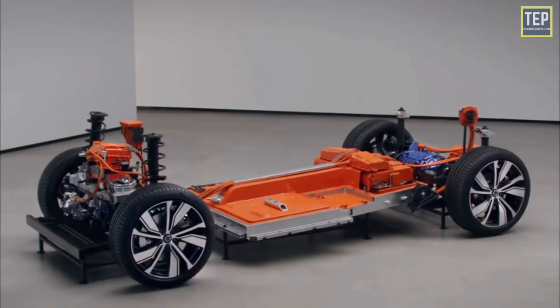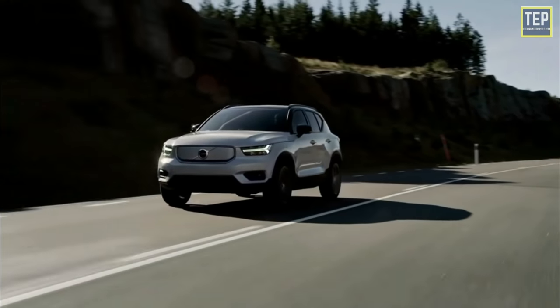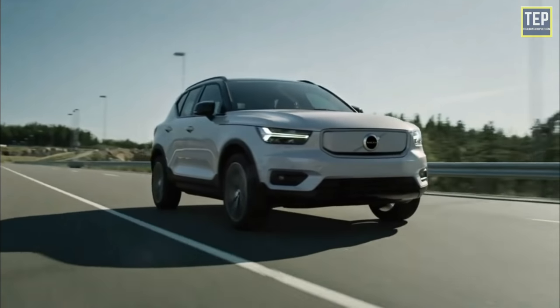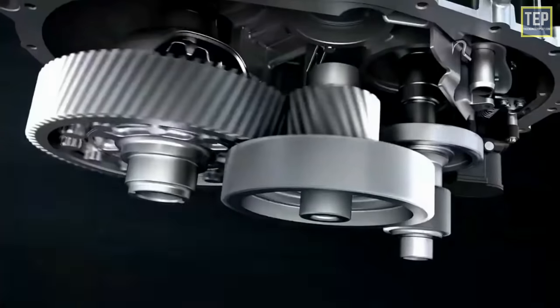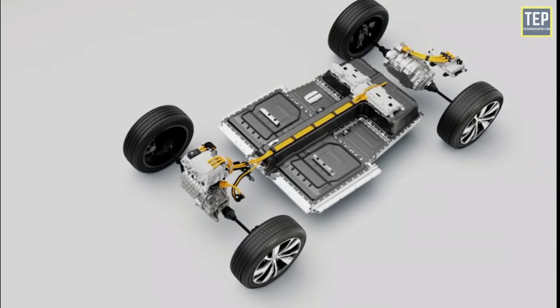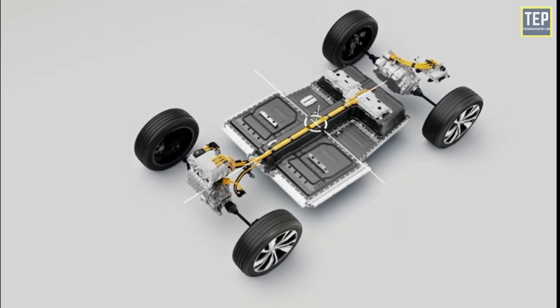With the AWD system and the dual motor, the car is able to distribute the horsepower and maximize the torque levels in immediate response to the road conditions. In this system, two motors are provided, one on each axle, and are coupled through planetary gear, and the torque is coupled through shaft fixed gear. Front and rear motor drives are supplied by one or sometimes two different battery packs.